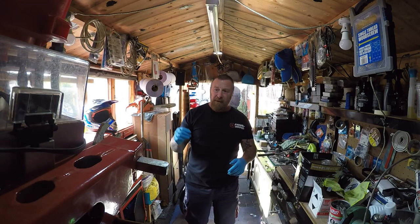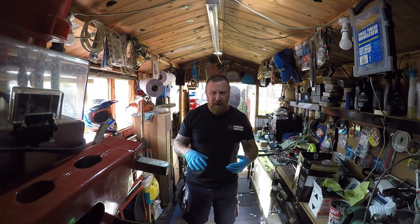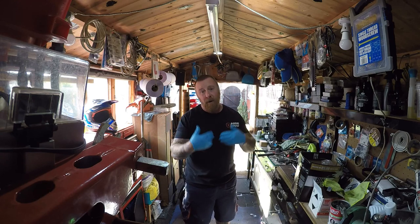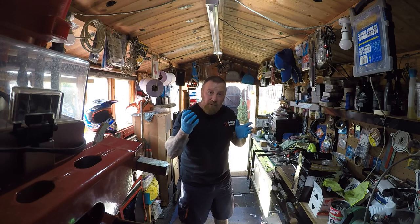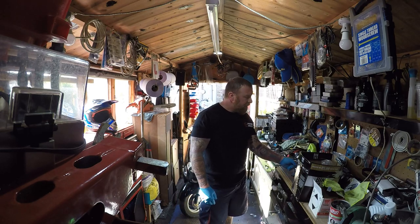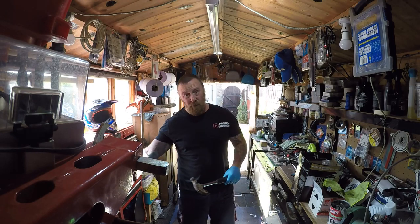I got over there and found that after I changed the rollers, there was no spark on electric — I had spark on kick but not electric. I wiggled some wires around, eventually got it kickstarted, it ran okay. Then going up the road it had a very slow puncture, the tyre came off and I had to take the back wheel off. To get that, you've got to move the exhaust off — honestly, they're not designed very well. And my claw hammer trick works on every bike I've ever worked on, but it doesn't work on these — they've got a plastic ring round them.